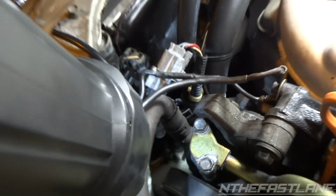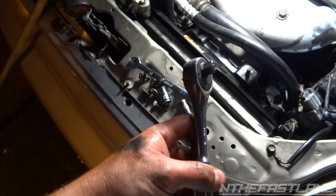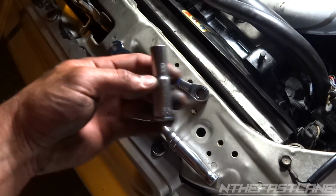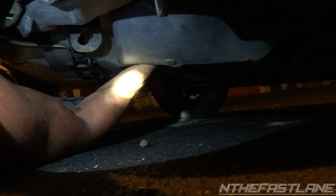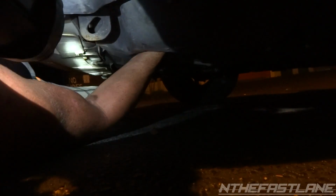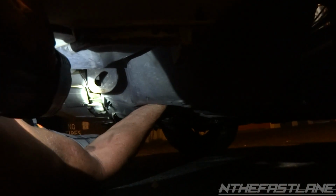The easiest way I found was from the other side. Let's just get a 3/8 ratchet wrench and a long 10. Alright guys, you're going to have to get under here like this, and if you can look and see where my arm is to get that last one, put the wrench on it, and if you can hear, I'm backing that last one off. This is probably the only way. It's really difficult to get to. And if you have a lot of this plastic under here, which this actually has, this is stock, so if I'm doing it, you can do it just the way yours is.